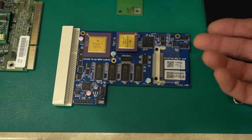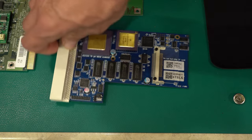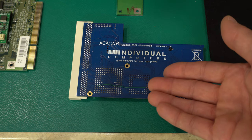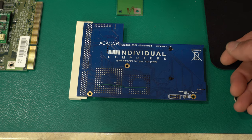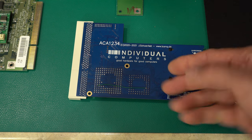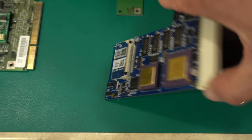Amiga 1200. And as you can see, I opted to do the self-mod for the FPU upgrade, as well as, let me turn around here, there we go, the Wirelink mod, which will help improve the compatibility of some demo scene demos, the Amiga demo scene that is, on the Amiga 1200. And this option is, once this Wirelink, as you see here, is installed, you can enable or disable it in their provided tool via software called the ACA tool.